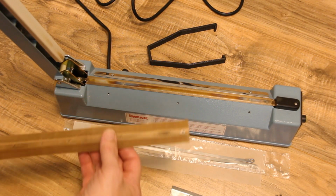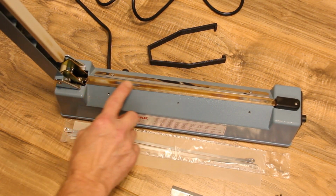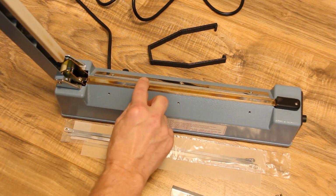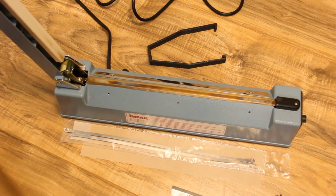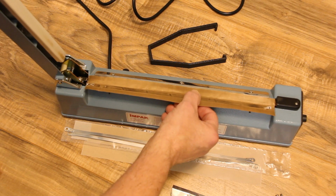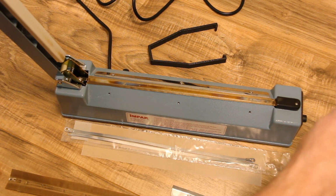I remove the top piece of the tape, but I keep it because I'll use part of it later. There are also holes in the Teflon tape under the heat strip. The heat strip is still working, so I won't replace it until it fails. I'll use a side piece from the old Teflon tape to replace the bottom piece.